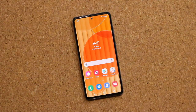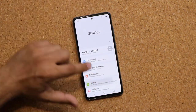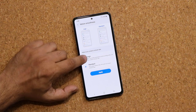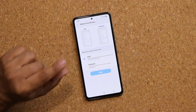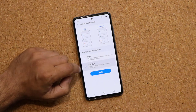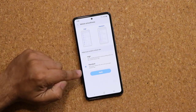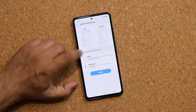The Samsung Galaxy A72 has a high refresh rate display. Go to Settings, then Display, and you'll see the Motion Smoothness option. You can pick between 60Hz or 90Hz — higher refresh rate gives smoother animations but your battery life might take a small hit. Some people don't see a big difference, so you can go with the standard refresh rate for slightly longer battery life.